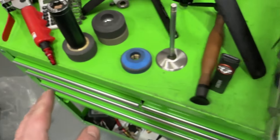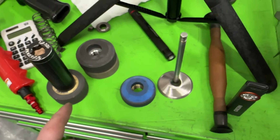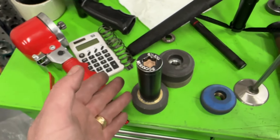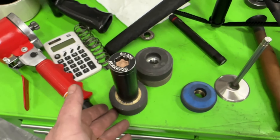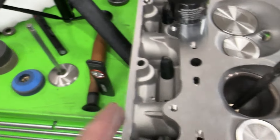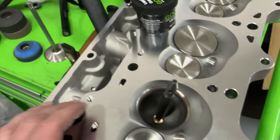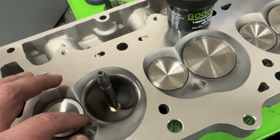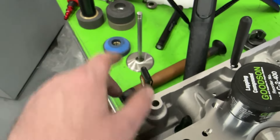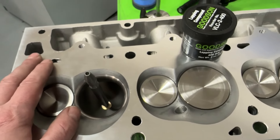To fix the problem I'm showing, you'd need a more aggressive stone — grind the 45 wide, then come in with different angles like a 60-degree under-cut and top-cut stone. So how much does all this cost? The stone holder is about $300, each stone is about $40, the carbide pilot is $375 — or get a steel one for $70. The air driver from Goodson is $1,100. And you still need a stone dresser or refacer, which is around $1,500. So to do the stone method you're looking at about $3,000.